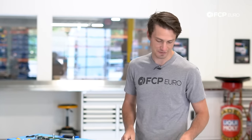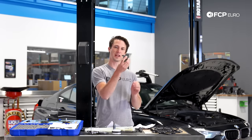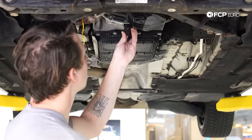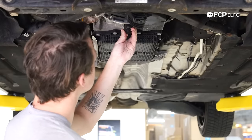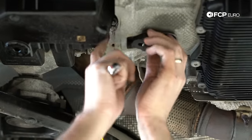Obviously if you're jumping into the N20 and N26 timing chain kit, you're going to need some specialty tools to service this job. We're going to go over the three main tools that are all offered on FCP Euro's website. The first one you're going to need is a flywheel holder. This goes in at your bell housing, clamps down, has some teeth from a sprocket, and it will hold your flywheel solid. This will make sure that your engine is locked at TDC, or top dead center.